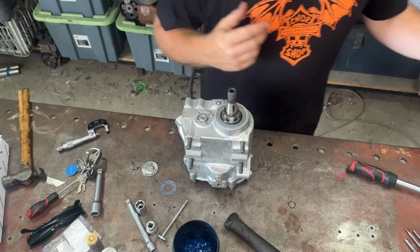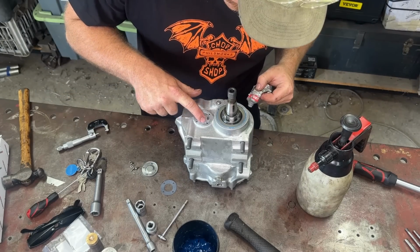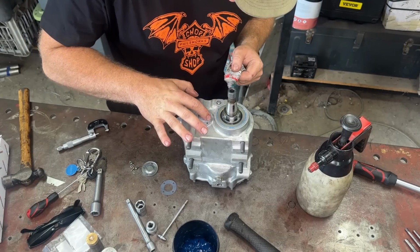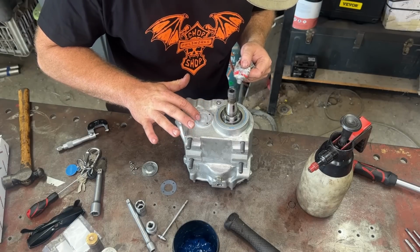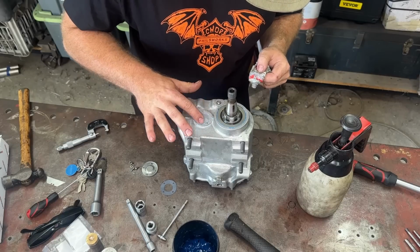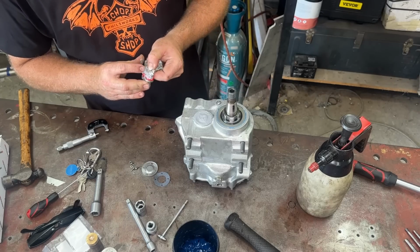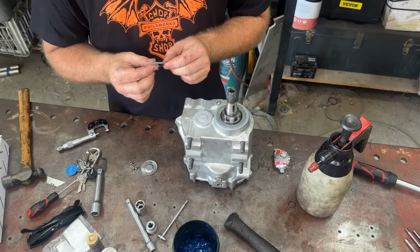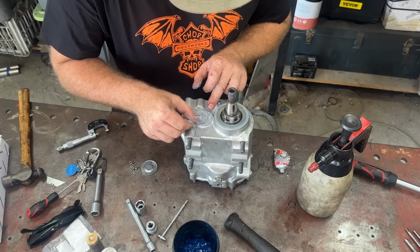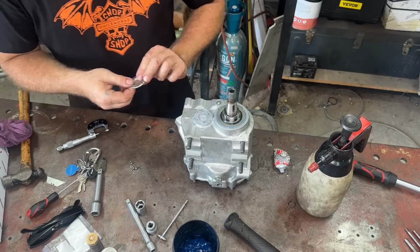So I have brake cleaned all of this. This is super, super clean. So what we do, get our goo, jam it all the way in there. Of course I get an itchy ear. Jam it right in there to stop all that oil from coming out through there. These things need all the help they can get to seal up. Gooed the hell up. And also, they have a seal that goes on them. I'm going to goo the seal as well. These are the little things that you do to make these gearboxes seal really well. Leak-free box is what we're aiming for here.